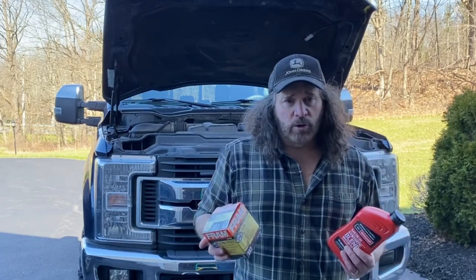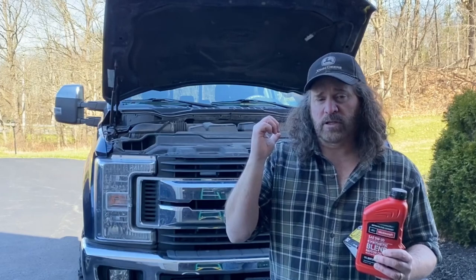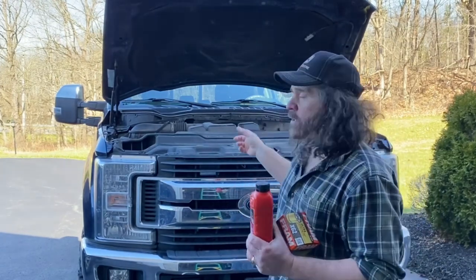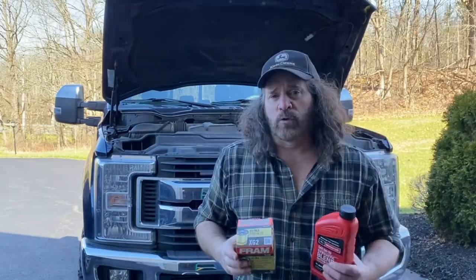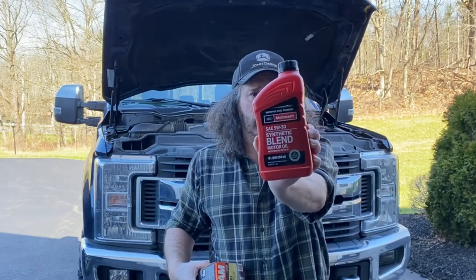So in this video, I'm going to show you how to do an oil change on my 2017 Ford F250 Super Duty. And it's got the 6.2 liter motor. So it calls for 7 quarts of oil, and I'm using Ford's recommended synthetic blend. Hopefully it's coming out on camera.